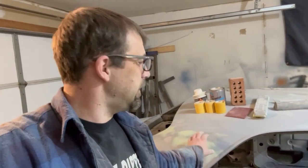And it's also going to seal up this putty. So when I put my high build primer on it, it doesn't soak up like a sponge and stays nice and level. It'll help increase the speed as for block sanding it and getting it back up in shape. And of course, in the future, like a year from now, as the stuff starts to shrink a little bit, it'll definitely help prevent the bleed through of those sanding marks, because I just don't like that. It's that little thing that just drives me nuts. I can see that. I've learned some of that stuff the hard way.